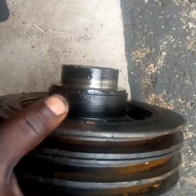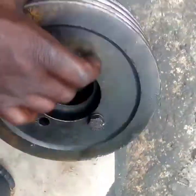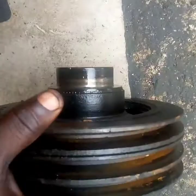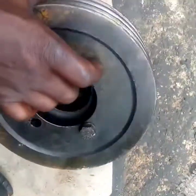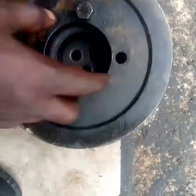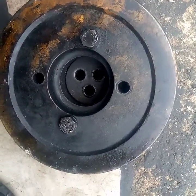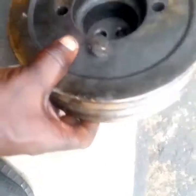What you are seeing on your screen is called a torsional vibration damper pulley, also referred to as a torsional vibration absorber. It is a pulley, but not an ordinary pulley. It is attached to the crankshaft, and with its help, your charging alternator, water pump, and sometimes your air compressor are driven. It is very close to the crankshaft so they can move together. Its function is to protect the engine from damaging vibrations.